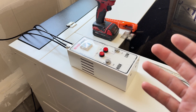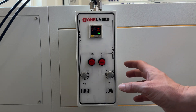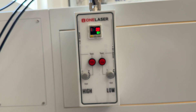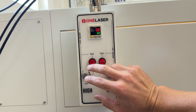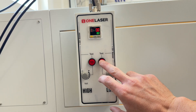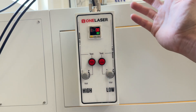We're going to power on the machine and make sure it powers up, then test everything. You can see we've got power to the unit. I've got about 60 PSI set in the compressor and about 50 PSI on our secondary regulator. Pressing test on our high flow, we've got almost 20 PSI — that's where I want it. I'm going to dial it in, turning to the positive side, about 20 PSI. And for the low, about 1 to 2 PSI — just a bleed of air.